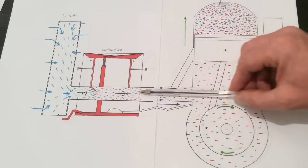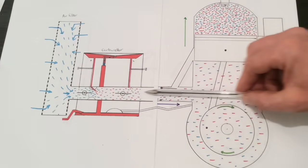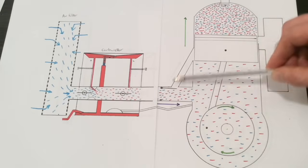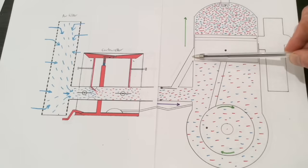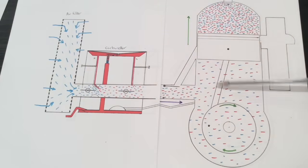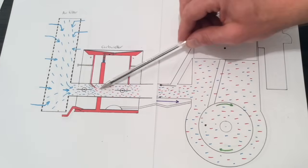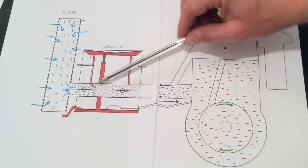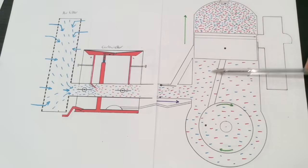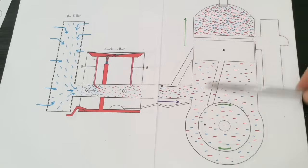This valve has opened because it's a one-way valve, and the suction coming in has opened it. And the air and fuel mixture that went above earlier through the transfer port is now starting to be compressed. The mixture — air and fuel with oil — has all come in again and is lubricating everything again. It's been atomised at the carburetor — that's the carburetor's job, to atomise — and it's done that job nicely again. And it will all be ready to be combusted on the next stroke.